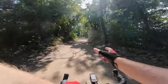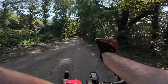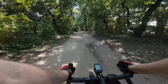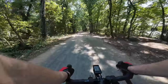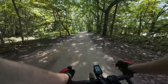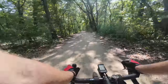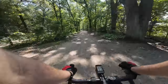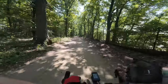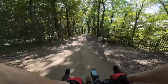Get a pair of dual piston, what's it called, disc calipers. And I think you're gonna get pretty close to the power of hydraulics. Of course, you got to keep your rotors clean and choose the right pads, but a lot of the issues people are having with disc brakes comes down to the hydraulics. And I'll admit, I have to keep a separate bleed kit for my disc brake bikes, and it's messier, it just requires more. Where a cable actuated brake, rim or disc, you just need a pair of cutters, an Allen key, and that's it. Super simple.